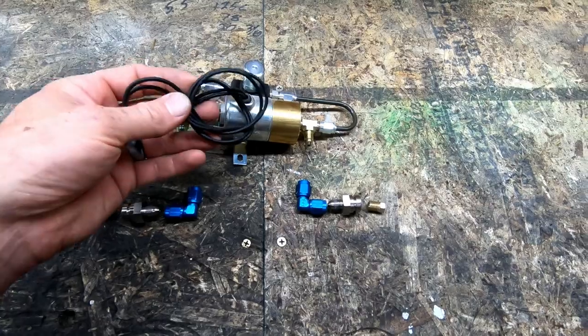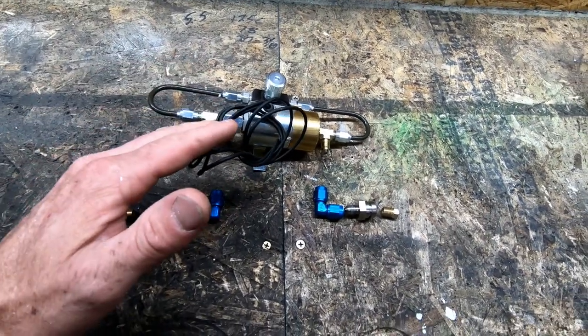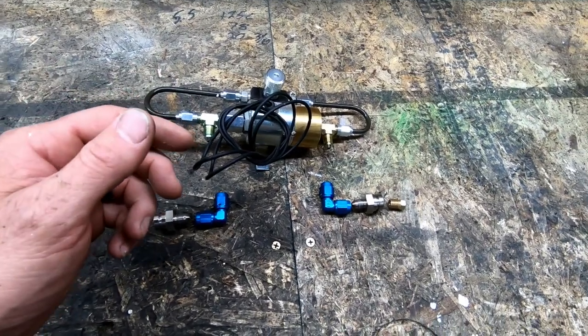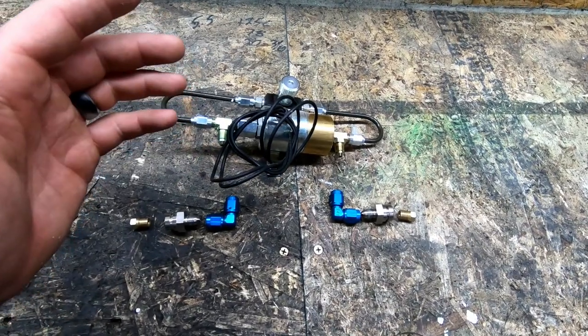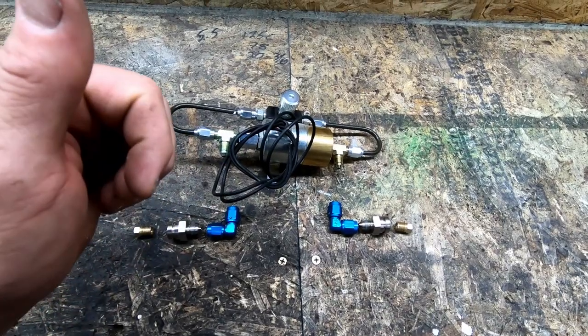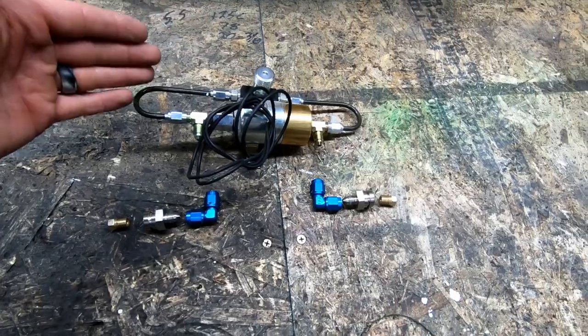And then I'm gonna wire this into the steering wheel to a push button, but I'm also gonna wire it into a relay that is hooked to the ECU. So this is only active up to about 15, 20 miles an hour. That way, if I get nervous and I just keep holding that button while I'm racing, it doesn't interfere with my other shifts.